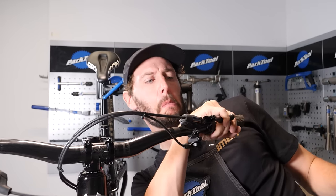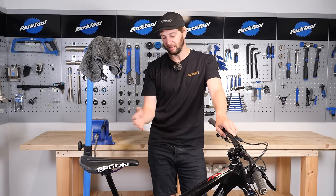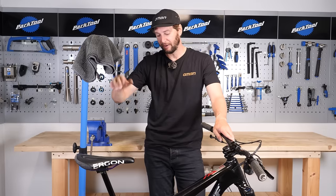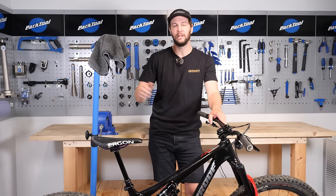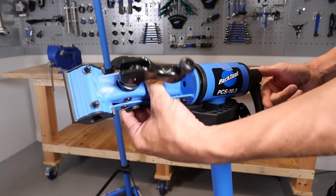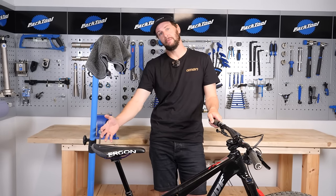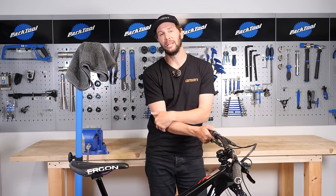Adjusting the saddle and things like that is going to be perfect. If you're working on parts of the bike lower down that are done up really tight and require a bit of force — things like the pedals or the bottom bracket — what I'll actually do is slide the stand almost all the way down so it's clamping the seat but with the bike sitting on the floor, just holding it nice and upright. That way I don't need to worry about the bike falling over, but I can actually get some nice force into the bottom bracket to undo and do it up — same with the pedals. Then, if I'm doing things like a brake bleed, I can rotate the clamp and drop it down slightly, rotating so the bike's pointing up ever so slightly to help that air escape. Then I can bleed the brakes nice and easy — I can get to the calipers, especially at the back, nice and conveniently, and just flow that fluid all the way up so the air's pushed up and out of the system.